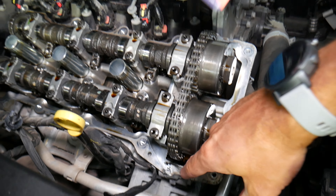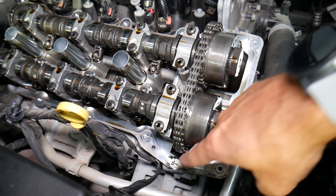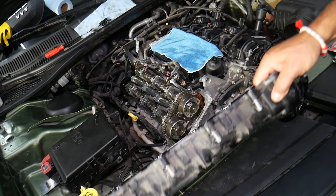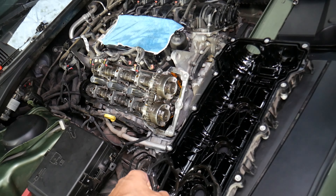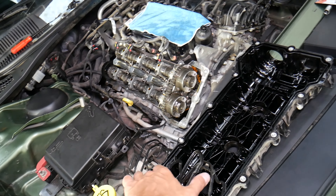Right here, you have to clean the silicone from those two spots — those are the two places where you will need to apply silicone. Clean the whole area with rubbing alcohol — pharmacy grade — then apply high-temp grey silicone. We'll put the link in the description where you can get it. Apply a little bit where the timing cover meets the engine block on both sides. If you want to see the torque specs for the valve cover, we'll have that video on our channel — Dodge Challenger valve cover torque specs and sequence — and it will teach you how to properly install it. Be careful not to drop anything inside the engine, because if you put it together with something inside, that can destroy your engine. Hopefully the video was helpful. Thank you for watching, and see you next time.